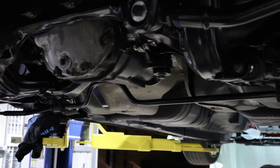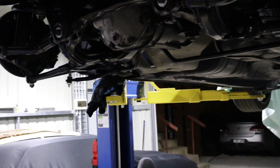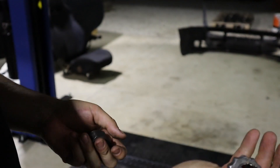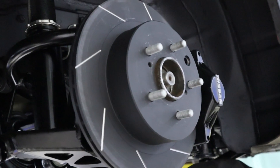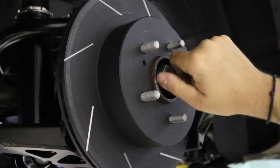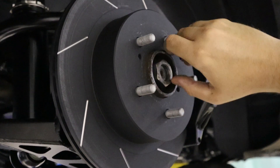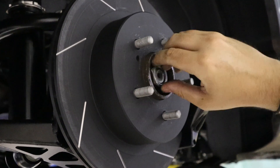They're all done. Next step is at the other end of the drive shaft. We've got a washer, a big nut — 36mm — castle nut, and then a split pin. Put the washer on, put the big boy in now. This gets tightened down really tight, somewhere between 250 and 270 newton meters. I'll get the gun on it first and then we'll get the torque wrench out just to finish it up.